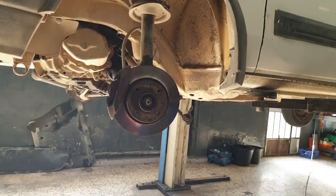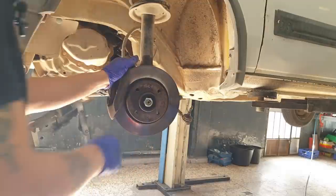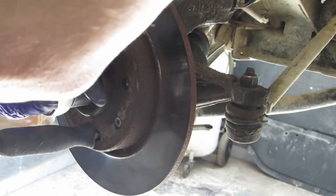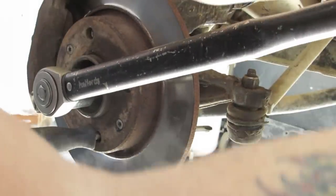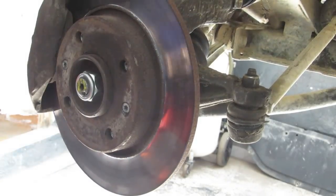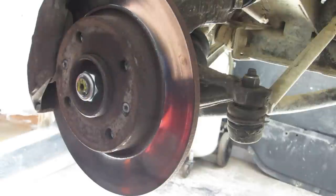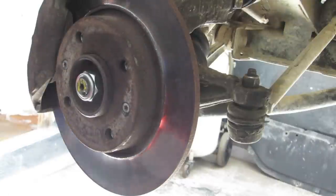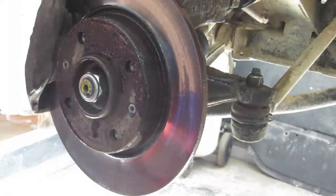Up and up. Some screwdriver through. Yes, I think I meant with the gun. Well, this is a new shaft, so the hub nut is different. It's a locking one, whereas the other side on the old shaft, it had the hub nut where it gets peened over. Get me mucky fingerprints off it.